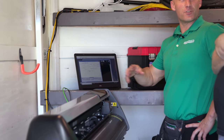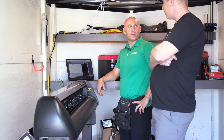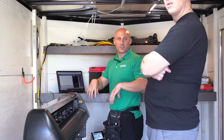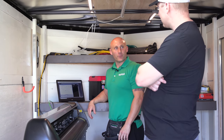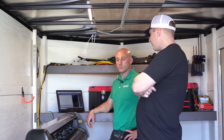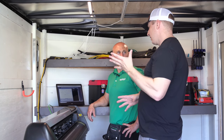Unrolling it where it's going to want to be and then shrinking around that — I'd rather just do the whole glass and hand cut it, because then I'm cutting where it's going to be once it's shrank and stuck to that window, versus trying to hope the shrink ends up where it should be. So this is the ceramic tint — this is their highest or ultra high end.